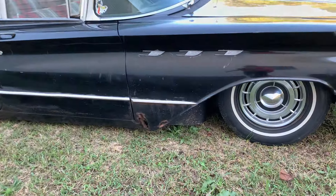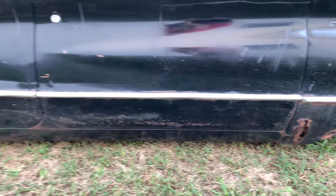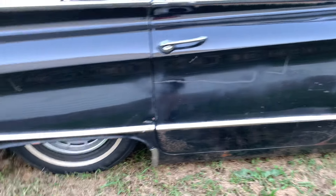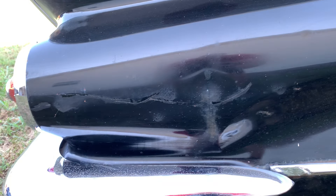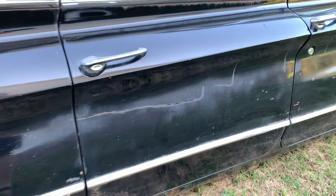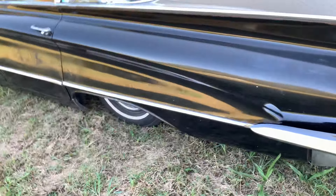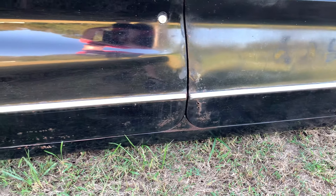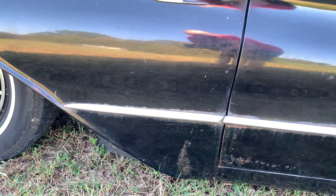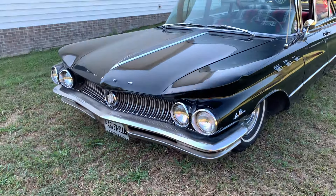You can see it has some rot down here in the lower portion of the front fender. The rockers are actually fairly solid on it, getting some rust on the bottom of the doors and behind the stainless trim. Somebody put a screw in the trim there to hold it on. Somebody's painted over some scratches in the door, and somebody has spray painted on this door as well. Lots of surface rust here and there, paint defects. The rockers are fine and that fender's not really that bad — all the chrome trim is a little pitted, bumpers have seen better days, but it's a good cruiser.